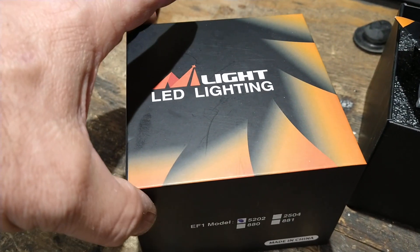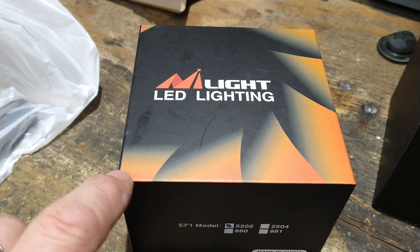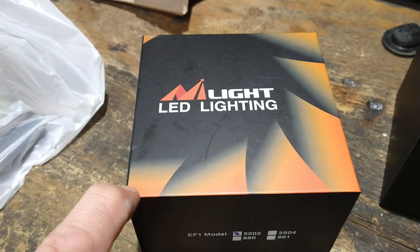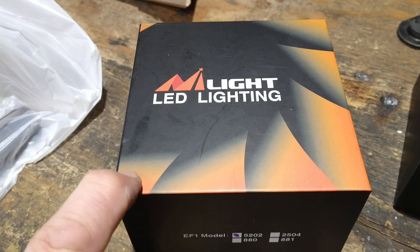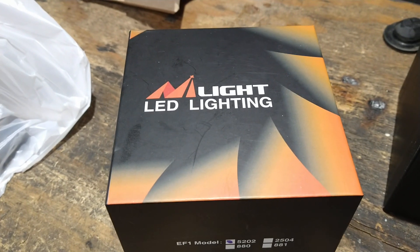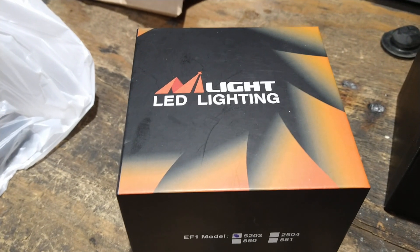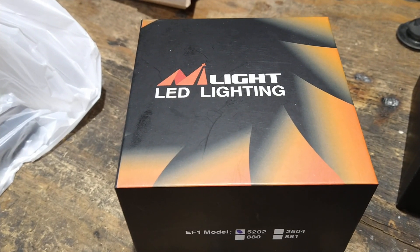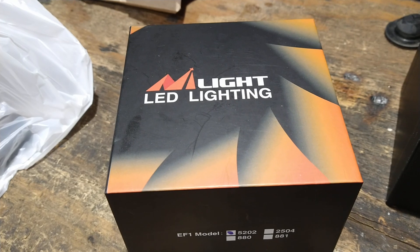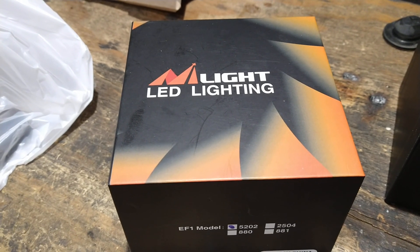These will be for the driving lights. One thing I wanted to mention and show is that when I installed the headlights, they work great — they light up the road, everything's great about them — except for the one thing that sometimes happens when you introduce LEDs to a vehicle. And that is, I had a lot more interference with the stereo, even the factory AM/FM stereo.